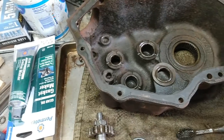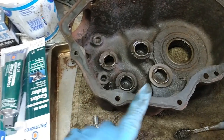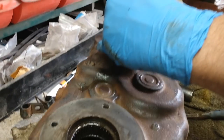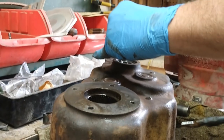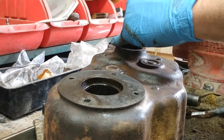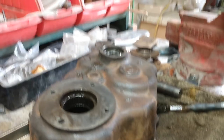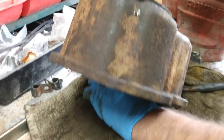I got some RTV gasket gear oil gasket maker — about 11 bucks — and I'll redo around the case and all the seals. Getting ready to go back together. Got the bearing started going down in there — it fits perfect. What I'm doing is just tapping it very slightly as I move the punch around; I don't want to get it cross-eyed. We'll get it down to where it seats. Want to be careful here — it's a good fit, it's perfect. You can hear the sound change and I know it's seated. Next we'll do the seal.